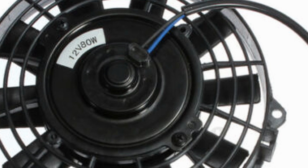I could get it going, but I had to start very slowly and work my way up. And in fact, I think the surge start amperage on these fans is more like 7 or 8 amps. So make sure you get plenty of capacity in your PWM controller. Mine's a 12 amp, so there's loads of capacity there. I mean, they are cheap, so don't skimp on that one.